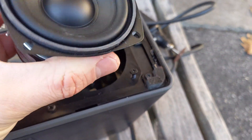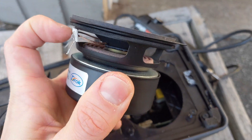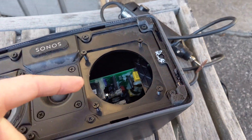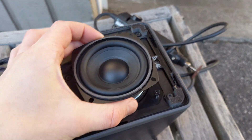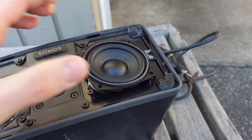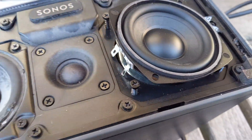What I'm going to do first is start with a template. I'm going to take my Dremel and route out a little nick in this corner so the speaker can sit as flat as possible, so I can get my depth on how big the adapter plate needs to be — because it doesn't quite fit as-is.